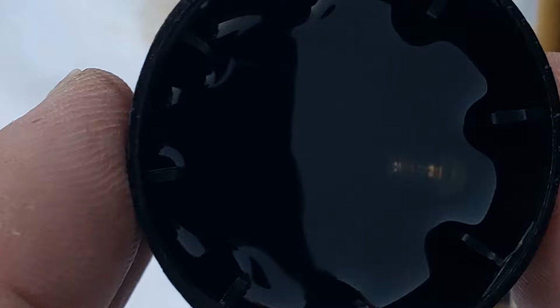So I went ahead and used a little trick that I do. I take the cap to the carburetor cleaner can, and I fill it up with the carburetor cleaner a little bit, and then I'll soak a small jet like this or another part in it. That's just an easy way to make a small bath for it so that it can soak and let the solvent start to work. I let it sit there for a couple minutes before I started cleaning it out manually.